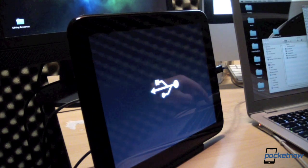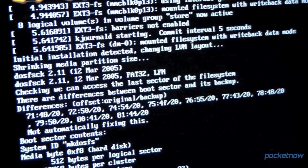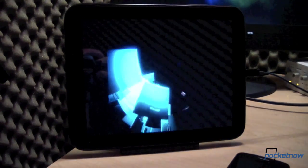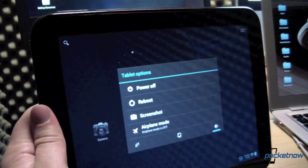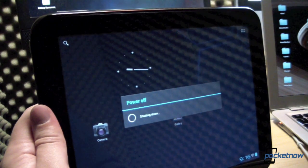Now we're going to hit Enter. Watch the HP logo come back, and boom — code. Lots and lots and lots of code. The Touchpad's going to do this for a little while. You're going to see a lot of stuff flying by on the screen. It's going to take a while and it's going to pause at points where it just kind of sits there, stares at you with a little blinky cursor and doesn't really do anything. Leave it alone. Don't unplug it, don't move it, don't look at it funny. Just let it be, and then it'll start again. And it'll start inflating all these files, and then we see something very familiar — we see the Ice Cream Sandwich multicolored Google rainbow dynamic shape explosion. It's good news, because we've got Android ICS now running on the HP Touchpad. But our work isn't over yet — we want to power the tablet off, because we have to make sure that we are getting all those Google apps installed properly.